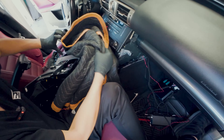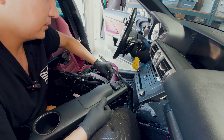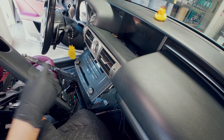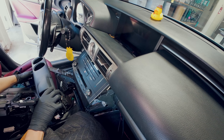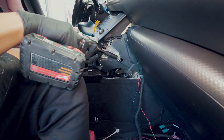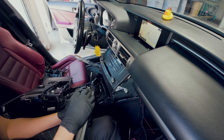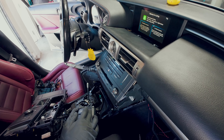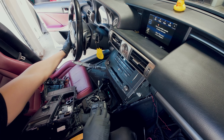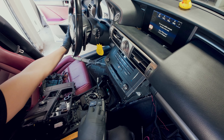So all that's connected — let me do a quick test. To do the quick test, you've got to connect your control back on. The other one is for your seat warmers — you don't need it. Put your car back to park. First time it's going to load — the screen is going to be black, just wait for the system to initialize. While it's initializing, let's take this time to start screwing on some bolts. Mouse is working — that's good. Press and hold the home button — it's working. Press and hold the home button again — back to the factory screen. From here, I just want to make sure our microphone is working. Looks like it's working. Terrific.